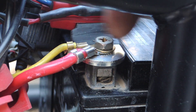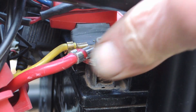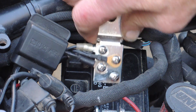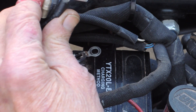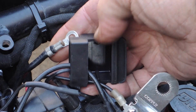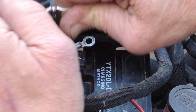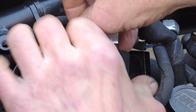The positive is all hooked up and it's definitely much tidier. Those are the two main OEM wires on top of the bus bar. The negative terminals are a little bit easier — we only had to hook up three of them plus the OEM ground. Have it all threaded up, so let's put the cover on and screw it together.